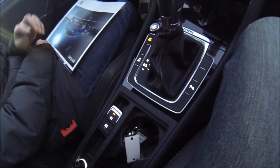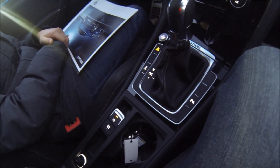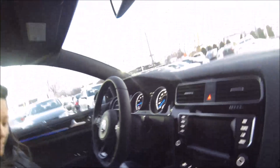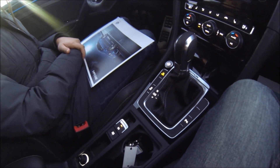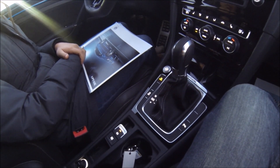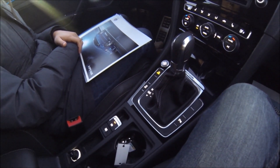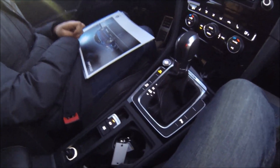Below that is the electronic parking brake. Right now the parking brake is active — you'll see the light on and a little red light on the dash saying 'park.' If you put your foot on the brake and press down on that parking button, you'll feel the pressure in the pedal go away and it'll release it. Then you pull it up to engage. This functions exactly like the older style lever — even in a panic situation where your brakes are failing, you can pull and hold up on it with one finger and it'll work just like the lever.